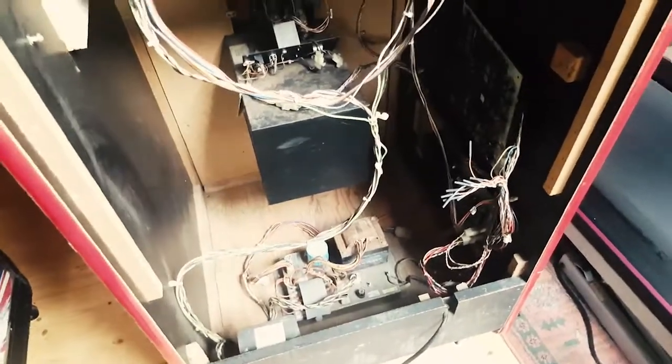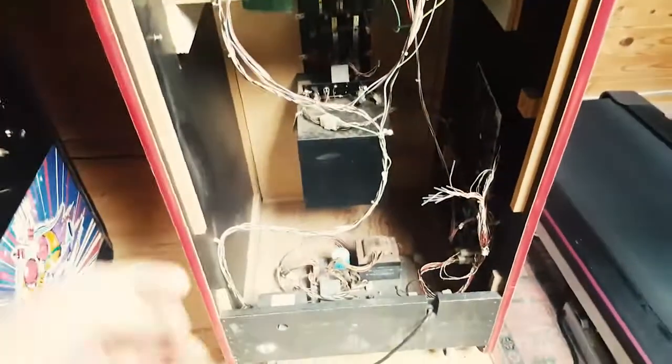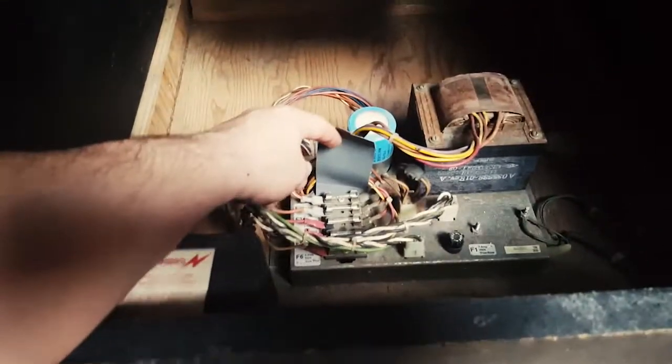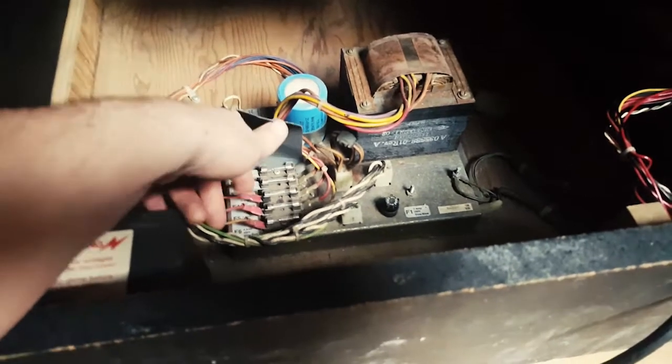There's only so many things that can go wrong, and it's a matter of testing things out independently. If this cab didn't start at all, I'd first check if the board is still fine on my JAMMA rig at my desk. If it's fine, it doesn't come from the board. So I'd start at the source — the power conversion — and look at what comes out of those pins. Get the schematics, check all the fuses, see what comes in and what comes out. If that's fine, I'd move up to the next stage, then check the wire harness for bad connections. It's just a matter of taking it one step at a time.